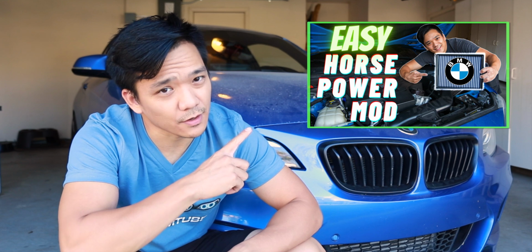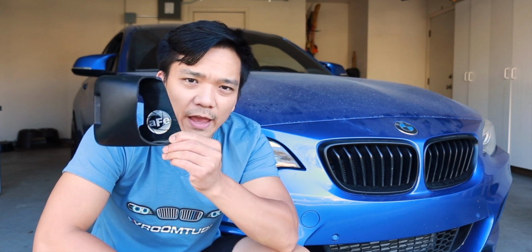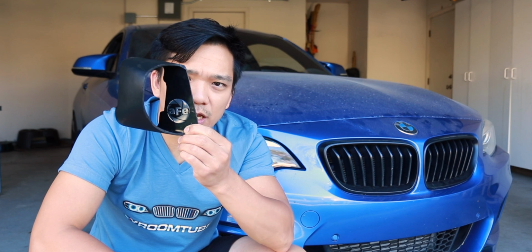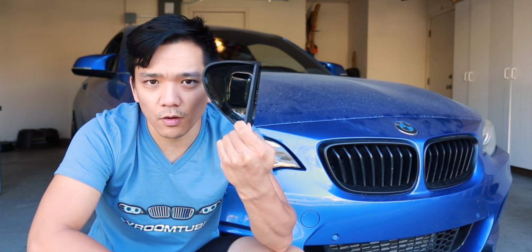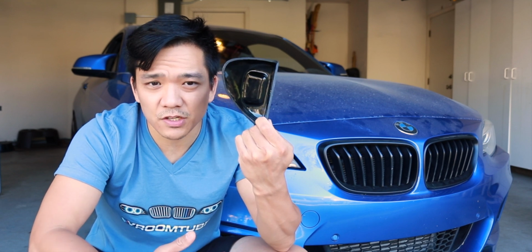Now, in case you missed yesterday's video, which I'll leave the link for you right over here, we went over why the stock air intake is more effective than most of the aftermarket cold air intakes on the market. However, even the stock air intake can be improved, and it can be all done for $50 with this air scoop from AFE. This is gonna bring in more air into that lower duct behind the driver's side grille when we're going at faster speeds, especially on the freeway.